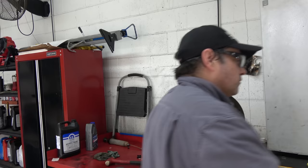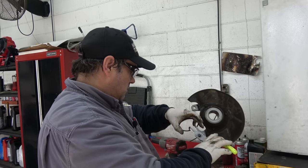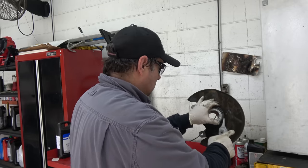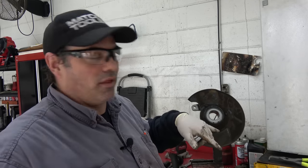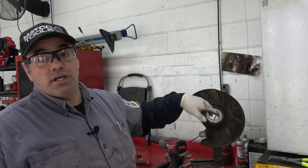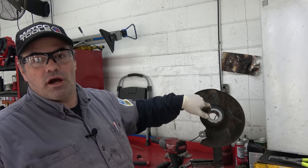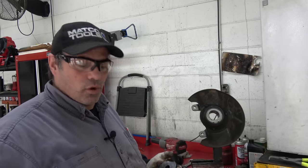That's as hard as it is. Of course, very important — don't forget your snap ring. Now on this car I don't have rust, so I don't have to worry about cleaning out the snap ring groove or anything like that. When we do the hub it's basically the same way, except you want to support the back race of the bearing. I'm going to point out that this uses a tone ring on the CV axle, not a magnetic strip. Now if you're using a bearing with a magnetic strip, one will be silver in color and the other will be some other color — that's the one with the magnetic strip. Make sure you put it in right because it sucks to have to press it back out.